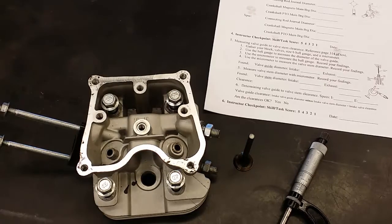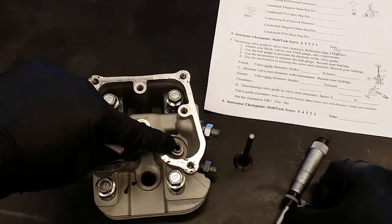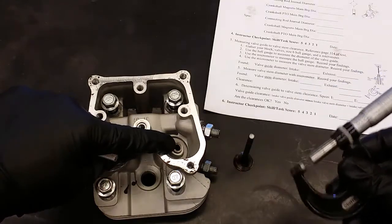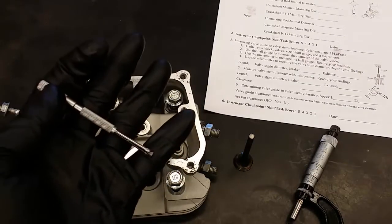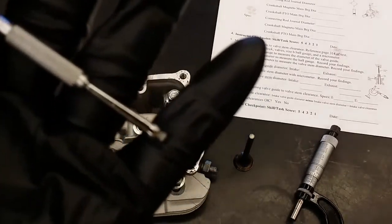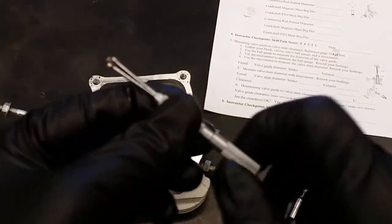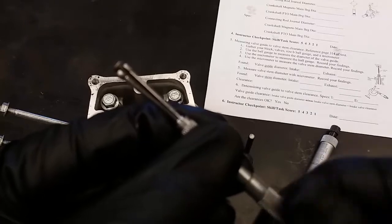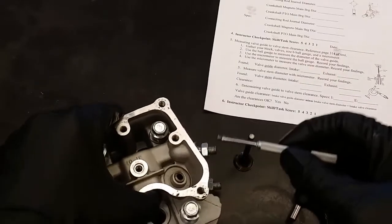What we're going to do is measure the inside diameter of the valve guide. Obviously it's an inside diameter and micrometers measure outside diameters, so I can't measure it directly. There are other tools we can use for this, but a fairly easy and inexpensive solution is the ball gauge or small hole gauge. It's a split ball, and it has a cone — as I turn the thumb knob on the end it draws the cone in between the two halves and splits them apart, causing it to get larger.